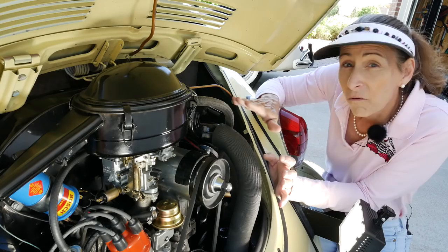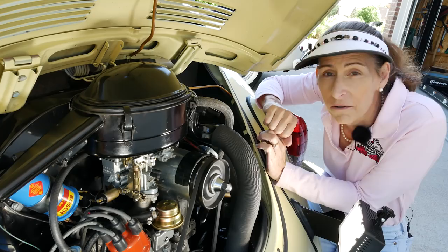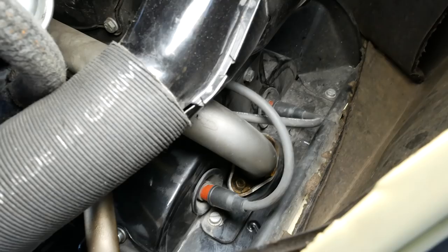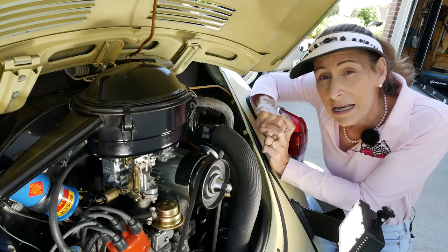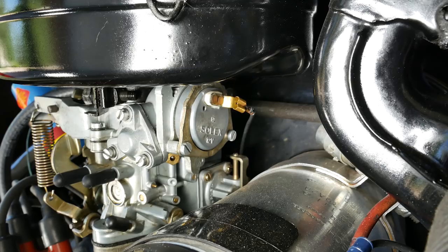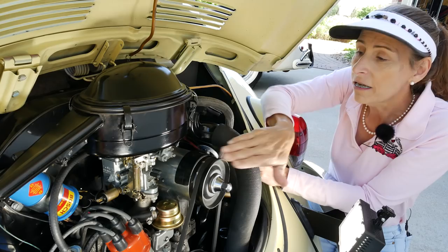The accelerator is now a cable on the Beetle, not a ball link system. The whole point of this engine is completely different than the 356 — look at the size of this engine bay, it's huge. You can get into it very easily and maintain the car easily. It's not highly stressed, so it doesn't wear out as fast. The spark plugs are a little challenging, but you can get them in and out in about 15 minutes. They want things to be easy to work on, reliable. One thing I really like is that the carburetor has a choke on it — the 356 doesn't have any choke. The 356 always runs lean and is a little fussy until it warms up. This car has an actual electrically activated choke, which makes it so much easier for a daily driver.